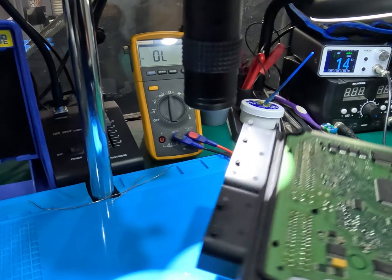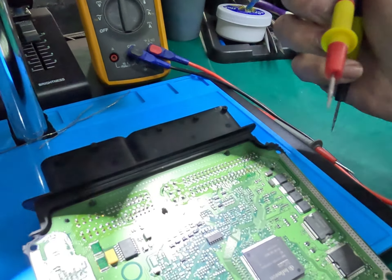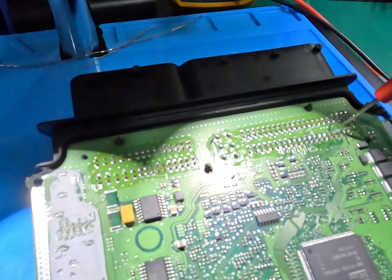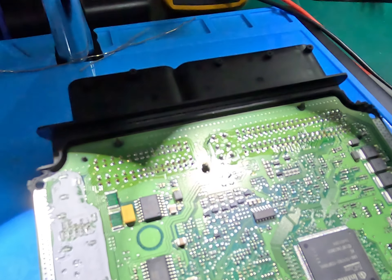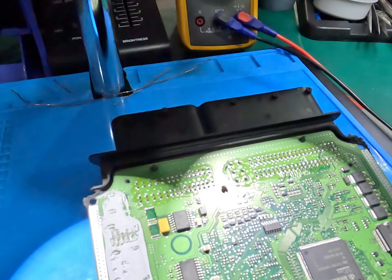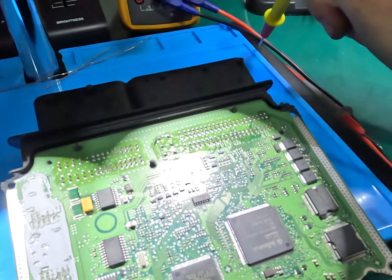The PCM powers up and does communicate. I've got no visual damage anywhere to indicate anything — no cracks. That orange stuff is just a lacquer across the connectors, it's not actually anything interesting. No shorts on any of our main transistors for coil control — nothing interesting at all. This thing tests all right.